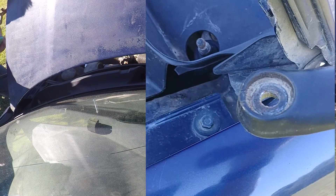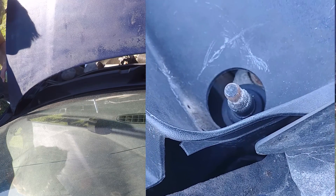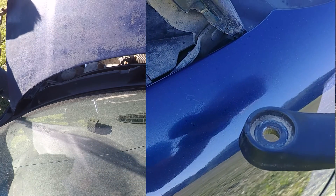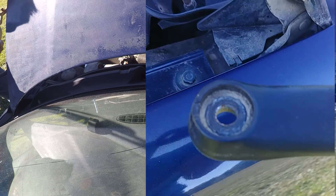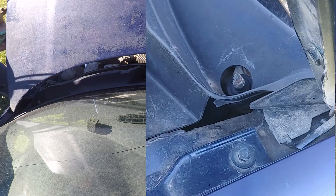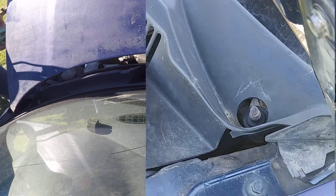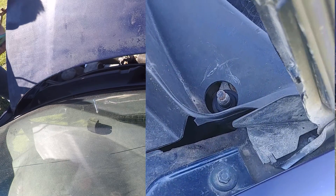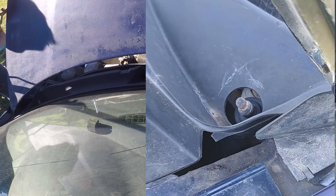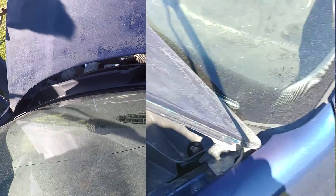The most important part about reassembly is that the spline inside here and the spline on the arm need to be absolutely clean. The last car I had the windshield done, I got the glass place to reassemble the cowl and the arms. When it came to wintertime one of the wipers happened to be a little bit stuck, and when I hit the wiper to clear the windshield the driver side one stayed put and the passenger side one went over top of it. I was able to twist the wiper arm on the post - he put it on in between splines and screwed the whole thing up. So when putting it back together, always make sure the splines are clean, put a little bit of anti-seize or other lubricant on them, and always put them together bottomed by hand then put the nut on - don't use the nut to pull it on.